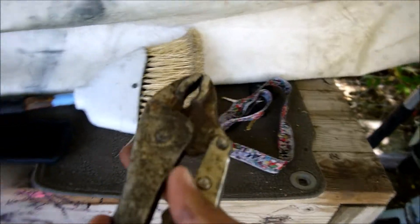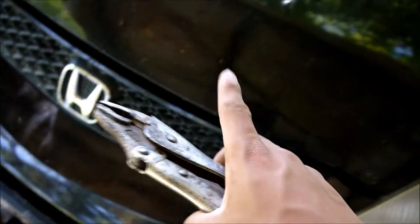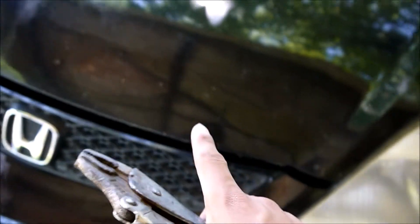I've got two bolts — one here and one over there — and the one over here already broke. I have half a bolt stuck in there and I need space for the other one to go in. I grabbed some vice grips and I'm going to pop the hood to see if I can get it from the top. If not, I'll have to drill it out, because I really don't want to put the new bolts in with half a bolt still stuck in there.